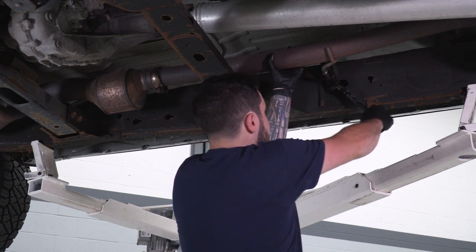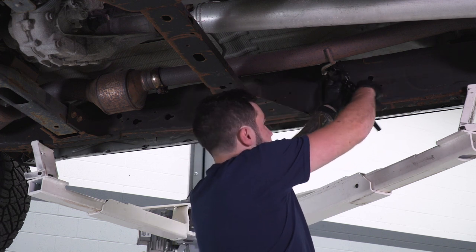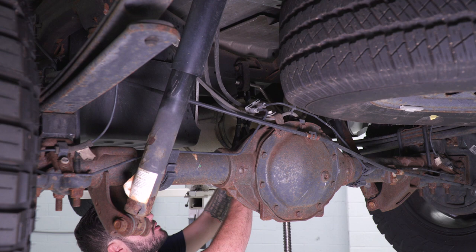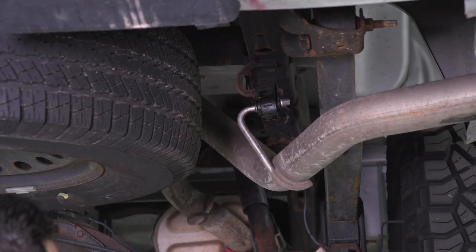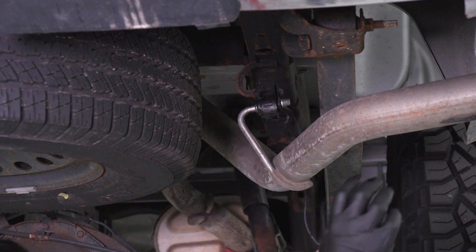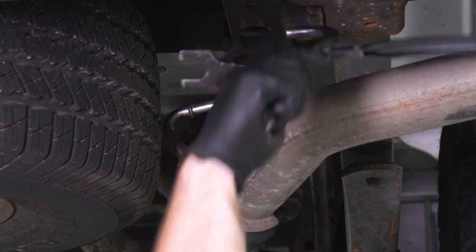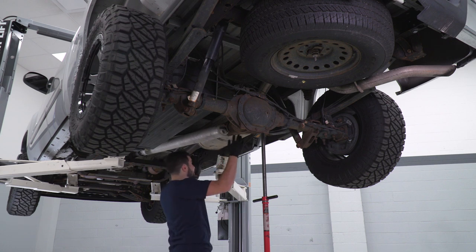Lubricating the hangers definitely goes a long way to make things easier. You can use WD-40 or PB Blaster or something similar just to help it slide out easy. Now we can move down the line and get the next two. For this next step, I have a pole jack underneath our muffler supporting it. We're gonna pop off the hanger right above the muffler, really right over the axle too. Having that pole jack or floor jack definitely helps give it some stability. Be careful because this is the last piece holding this guy up, so it's gonna get pretty loose and wobbly. Once you pop this out, you can take the entire exhaust off all in one piece. This may be easier with a helping hand if you have a friend on deck, but it can be done by yourself — just make sure you're being careful because it is still all one piece.